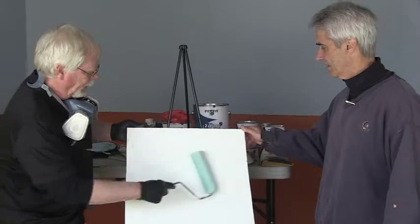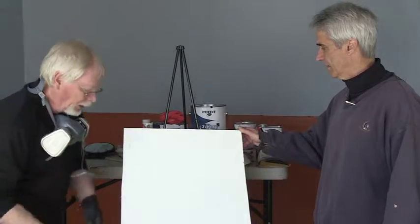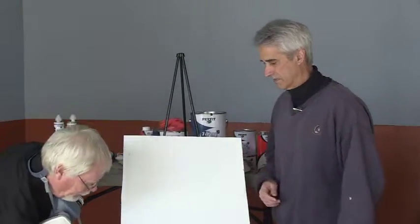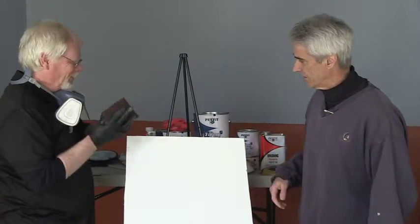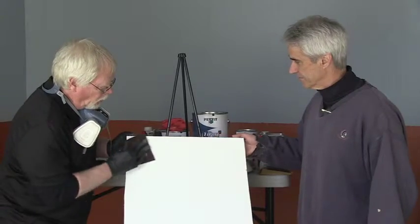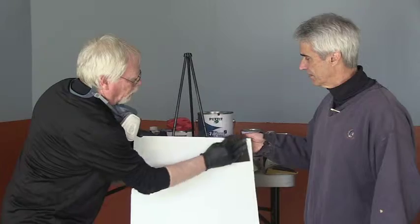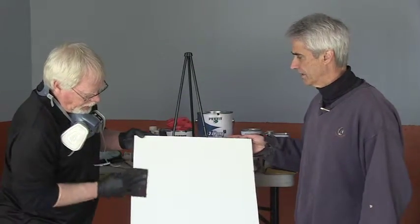I know that I've applied it to all the areas, and now we work it in with a Scotch-Brite pad. My Scotch-Brite pad is right here. We work it in circular motions. It has a little grit to it, so it'll help remove the mold release waxes and at the same time get your sand dust off. And either technique can be used.